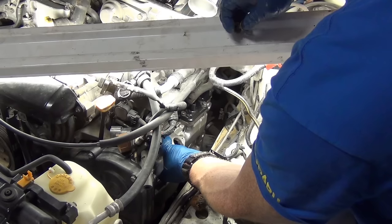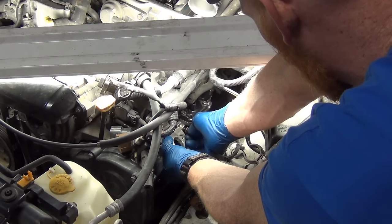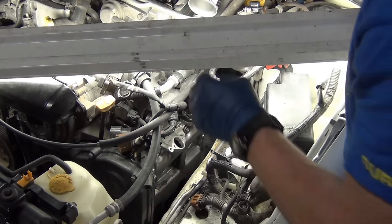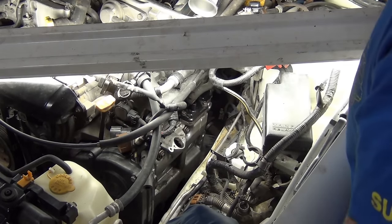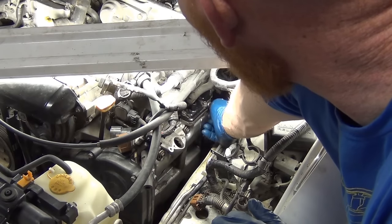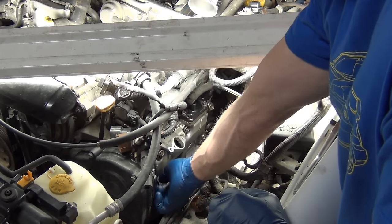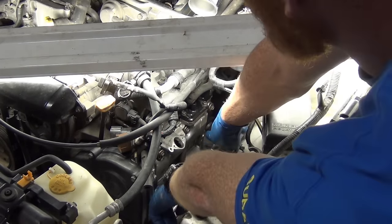Controlling it the whole way - not trying to angle it in, trying to get it in there straight down first. First bolt to go in is my picture-hanger bolt. Get it to slide back and forth wherever it sticks in that first little spot - you don't want to drag it too far and suck the gasket out. You just want it to land where it lands. It's like slapping something in the mud trying to get it to stick. These little gaskets grab the bolt from the middle so when you turn it, the bolt turns with it to a degree. I'm putting everything in finger tight first, then we'll start in the middle and work our way out.